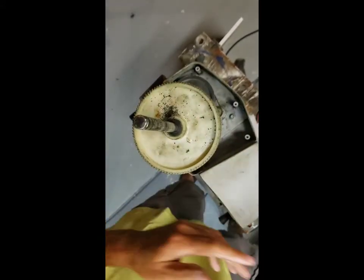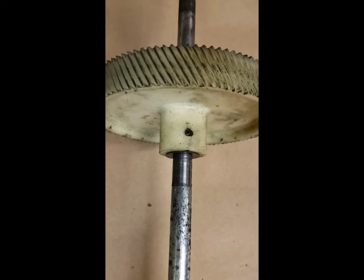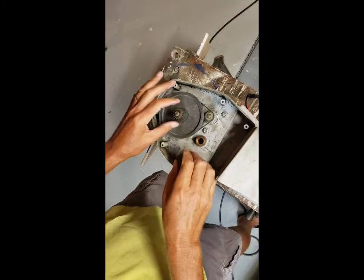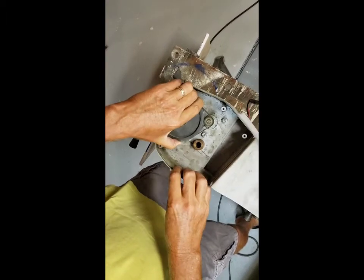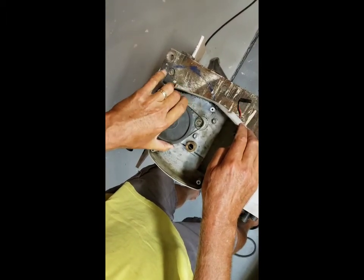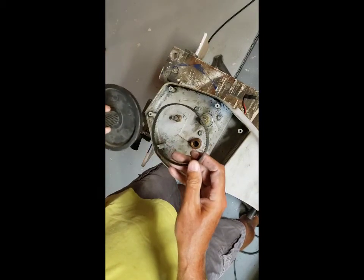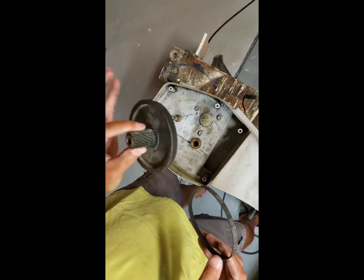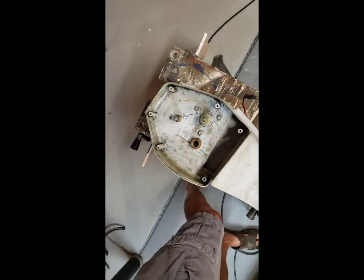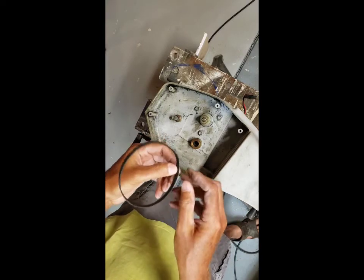Now that gear on the axle is held in place by a roll pin right through the axle. Sometimes that roll pin will break. So if your cart motor is running and your wheels aren't turning, one of those two pins — either this roll pin or the pin on the axle — could be broken. Cheap repair, but you've got to take it apart to do it. I'm taking the belt off of the motor gear. You just work the belt up, lift that gear right out, and gradually get the belt to come off of the motor. Inspect that gear — I've never really seen one go bad. It's good to have a spare belt on hand, but again I've rarely seen a belt break. If your wheels aren't spinning and your motor's turning, it's a pin, not the belt.